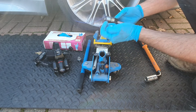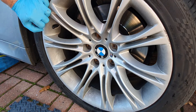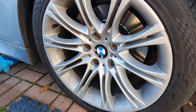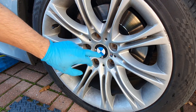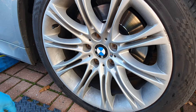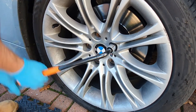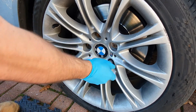If you've never taken off a wheel before: once you've put your jack in the correct jacking point underneath the car, before you actually jack the car up and lift the wheel off the floor, just loosen the nuts first. Because if the car is jacked up and you try to loosen the wheels, you can put a lot of stress and strain on the jack and it's not very safe - plus the wheel will spin. So just crack them off like that.